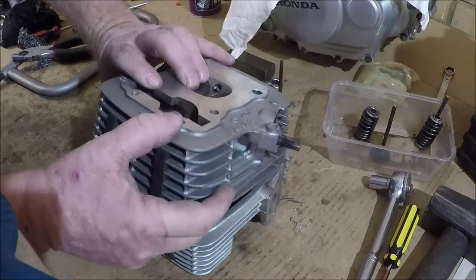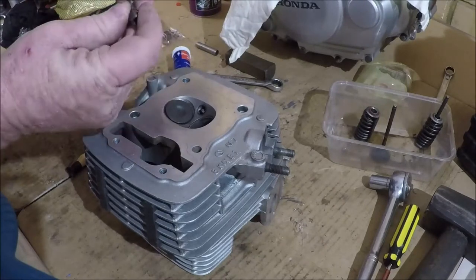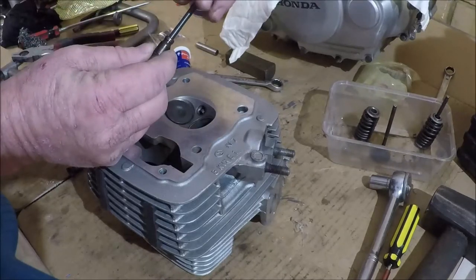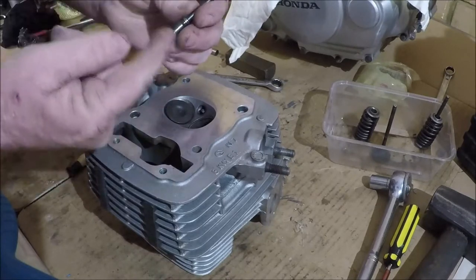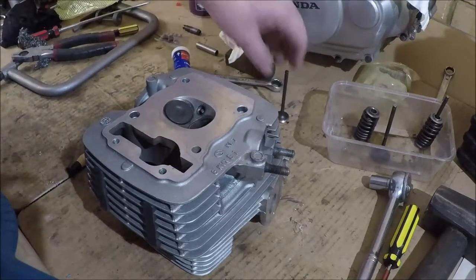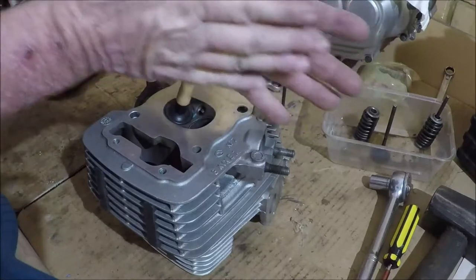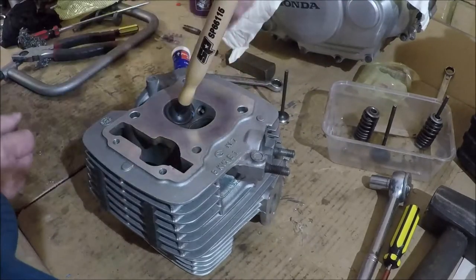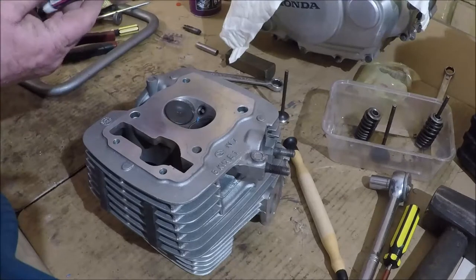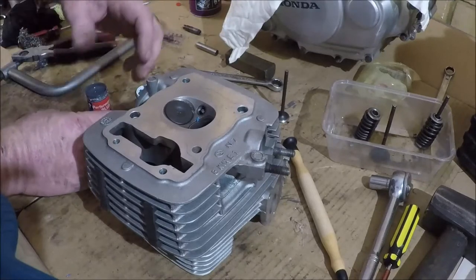If you get the valve grinding paste between the valve and the valve guide, that's the way she goes on. You can imagine, we start doing what we call lapping. This will mean that you're actually using that abrasive powder to grind away at the inside of the valve guide. And we certainly don't want that. Excellent. Now the dolly is just a suction cup. It's not a very good one either, by the looks of that one. And we're going to use it to actually rotate the valve.